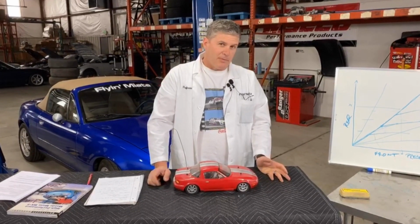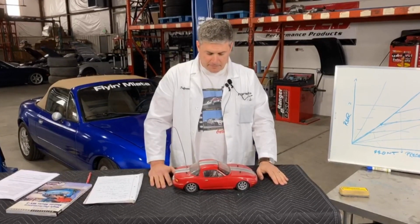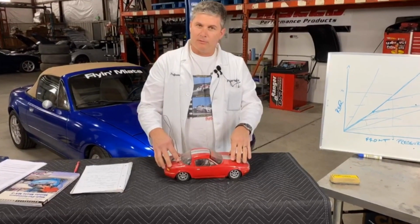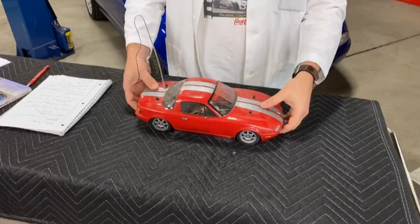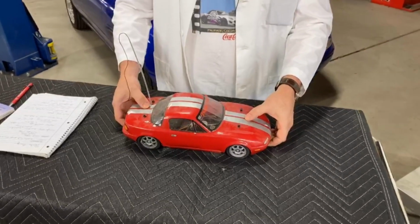So that's single stop. It's actually pretty easy to understand. Use all the traction you have. Oh, one more thing about weight transfer is, of course, it's related directly to how tall your car is. The higher your car is, the more transfer it gets. So all you guys running around on 3-inch lift kits, you're going to get more weight transfer. All you guys who are slammed, you get less of it.